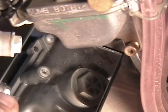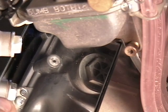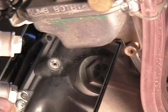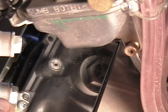By placing a small mirror underneath the carburetor, we can see that there's a cap covering the opening to my fuel screw. I'm going to need to first remove this cap to gain access to the fuel screw before we can remove it. Oftentimes the dealer will have already removed this for you, so it may or may not be there. On my WR, the dealer removed the plug in the bottom of the carburetor, so I didn't rotate the carburetor, I just removed it the way it was.